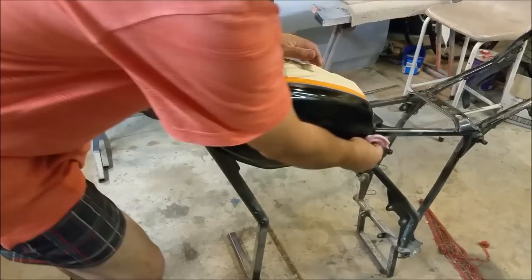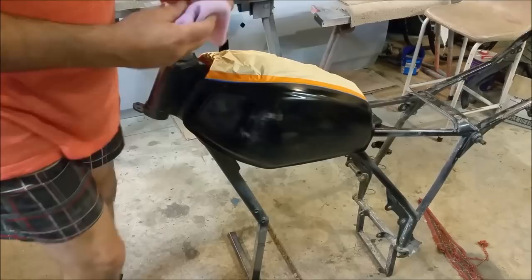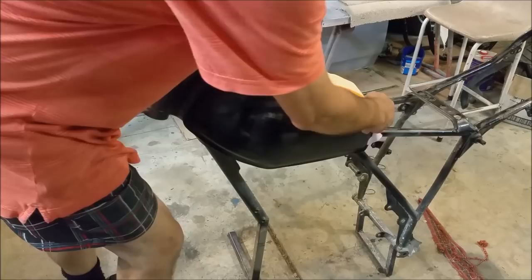I'm not taking them out. This is acrylic paint, so the deal is this. The paint's going to dry a meter out of the gun and just fall to the ground. You can get away with that with acrylic. You couldn't even think about doing it with an air dry enamel or a two pack. We need to remove everything altogether, but acrylic's fairly safe, I think. So just wash this off.